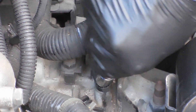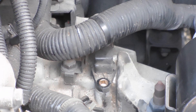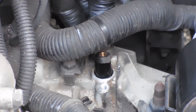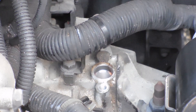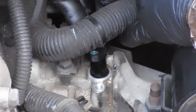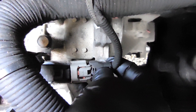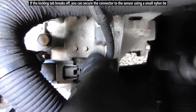I'm going to remove the 10-millimeter bolt holding the output sensor in position, then very gently pry under the sensor to release it from the transmission — be very careful not to let anything fall inside the hole. The removed sensor is a three-wire sensor. Place a finger inside the hole to check for debris on the top edge. Insert the new lubricated sensor and press it all the way in until you feel it pop into position, then put the bolt back and tighten it down securely. Slide the connector back on, make sure you hear a click, then give it a wiggle and pull to confirm it's secure.